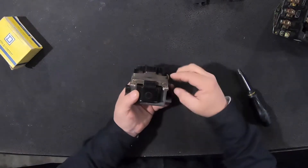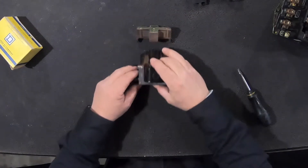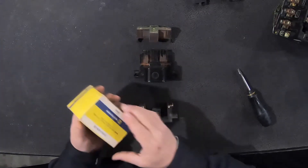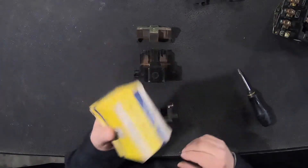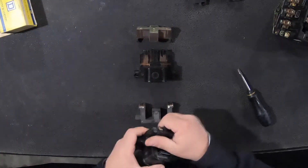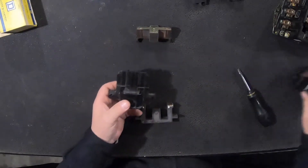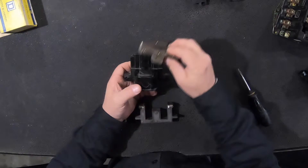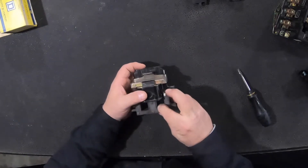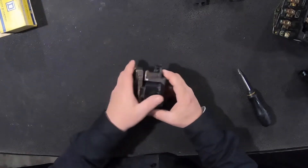In the back of it we've got our iron, which is the magnet portion. Take that out and lay it aside. Then take our new coil — this is a surplus coil we have on the shelf — pop it out. It's a 120-volt unit; got a little dust on it, wipe it down. Take your bad coil, set it to the side, take your new one, pop your iron in, pop that second piece in. Always make sure you've got free travel.